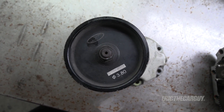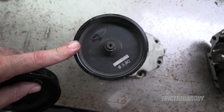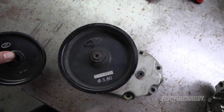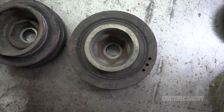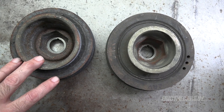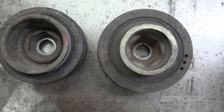One of the cool things about superchargers is if you want them to make more boost, you just change the pulley. The supercharger came with two different pulleys — here's the larger one and here's the smaller one. The smaller pulley spins the assembly faster, thus making more boost. I may actually go with the larger pulley just because I don't necessarily want to run high boost — I just want to help the engine along at lower RPM. Another way to get more power out of the supercharger is to install a larger crank pulley. A popular upgrade is to install a CRV crank pulley, which is larger, and that also makes the supercharger pulley spin faster.